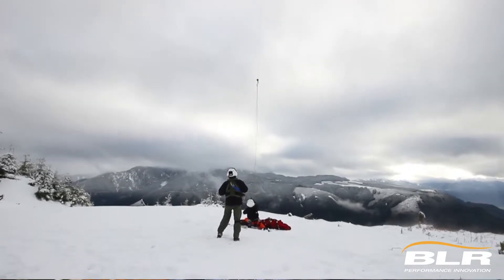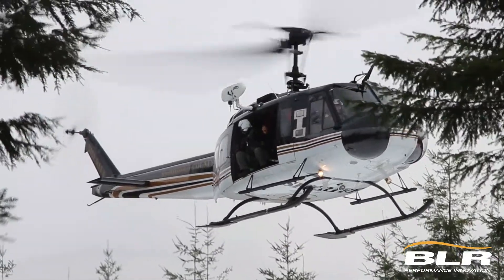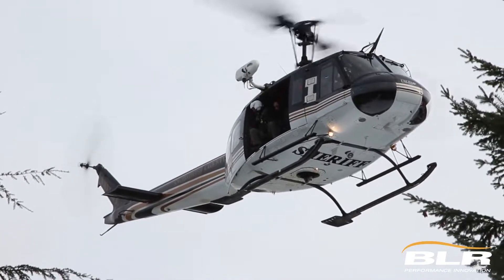In the military we had a technique we called the Huey Shuffle. This was something that we taught our students and it was something that we did every time we took off in the Huey. The Huey Shuffle is when you're taking off, increasing power, and you're adding left pedal to counteract the torque effect and the downwash and wind effect on the tail boom — adding that left pedal, taking it out, adding it back in as you go through translational lift. With the strakes installed, the strakes break up that wind effect and your pedal movement is very minimal.